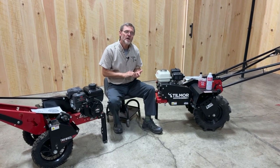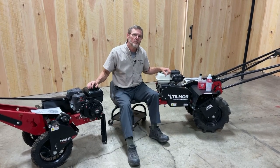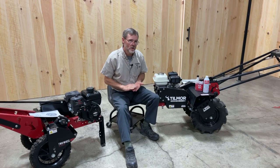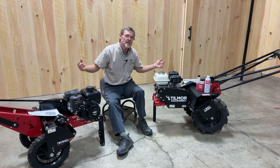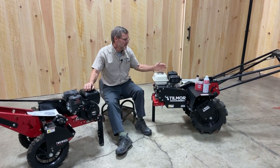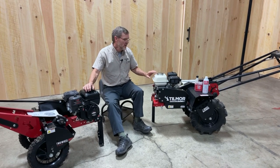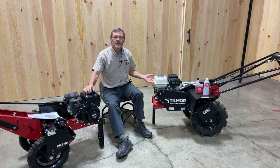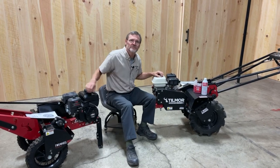But when it does come time for winter, there are a couple of products that are very helpful, so that in the springtime when you pull out your equipment, you fire it up and it's ready to go. One method is to drain the tank. It even discusses that in the manual, and how to do that. But if you fill the tank, you remove air, less possibility of condensation, and when you pull that cord in the springtime, it's much faster at running.